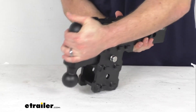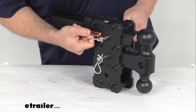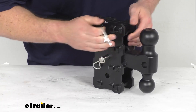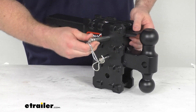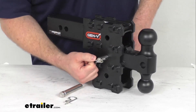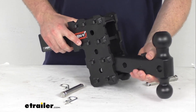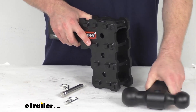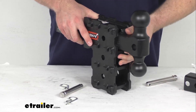It's very simple to adjust our height setting. Our pintle block here can be slid in — there are multiple holes, so if we don't need it we can slide it back to have that opening for our ball coupler, or we can pull it out if we do want to use a lunette ring. To adjust our ball height, we can simply pull out the pin and clip, move it down to the lower setting or up to the higher setting once we have that pintle lock pulled out. We can adjust that to wherever we need it to be.